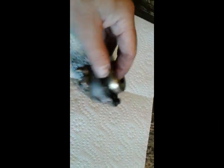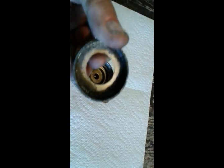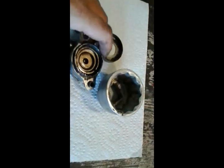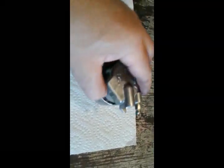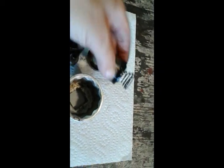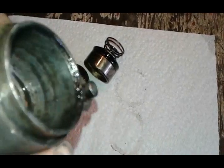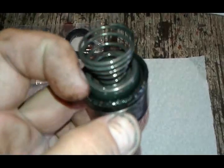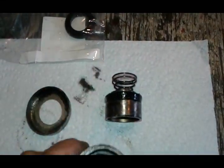I cleaned this a little bit with my wire brush and then with a screwdriver I just popped this little cover off. You can see how dirty it is inside. Different bikes have a little different setups. Now we have this piston right in here — you don't really need to pump it out. I have a big socket here; I can just bang it and it comes out easy. This is what the piston looks like, and even though the inside looks nasty, it's mostly just dirt and grime. With fine sandpaper you can clean it right up, and we have our new seal that goes in here.